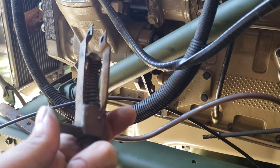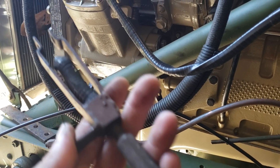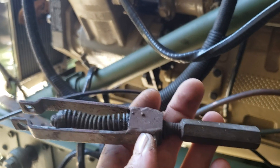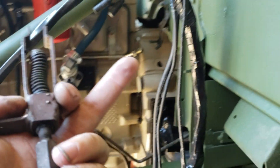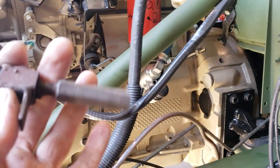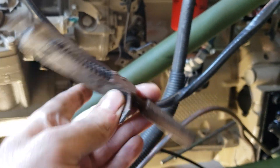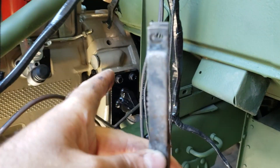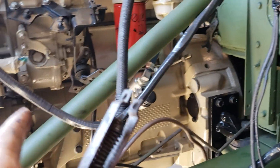By the way, you won't need to use a throttle return spring like originally the multi-fuel had on the linkage connected to the steering box, because the P-pump has its own throttle return spring built in — and it's pretty stiff. Of course, if you want to use an extra spring you can, but it's absolutely not necessary. Now, the downside is we're not going to have that spring-loaded override anymore. So if you depress the pedal too far and your pedal stop isn't adjusted right, this is not going to take up the excess — you're going to end up bending something there or on the bell crank down there. So keep that in mind: when you do this, you're definitely going to want to adjust your pedal stop properly.